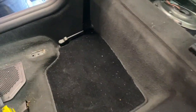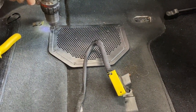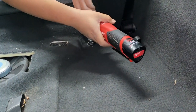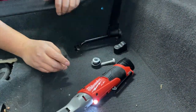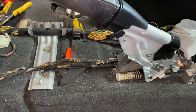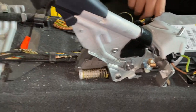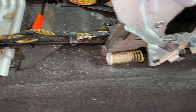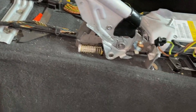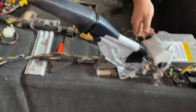Now we're going to try to remove this back piece of carpet. The speaker covers are screwed into it so we have to remove those first. Now the dilemma for the middle of the carpet is there's a whole lot of stuff still attached to it. You can either take it all off to remove the carpet and put it back on, or you could just slice it on the inside so you can take it apart from the sides and around it and leave the center still bolted in - so if you wanted to go back to stock you could tuck it under and put the center console back on.